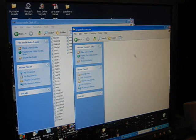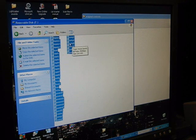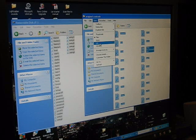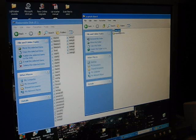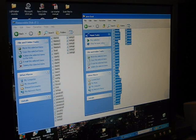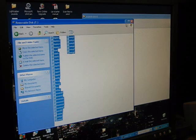Double-click on Original Contents. We're going to go over to our SD card, which is still sitting here. Control-A allows you to highlight all of those files, and when you're going to and from a card you can just drag and drop — you don't have to copy. So we're just going to drag these into our new folder. I'll go to View, List again so they look identical. Original Contents is now an identical copy of what's on our SD card. Now I'm going to go to New Font and do the same thing — drag these all into New Font as well. Both are now identical copies of our SD card.